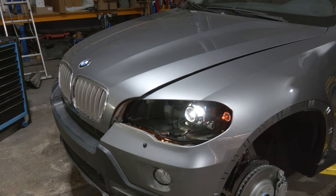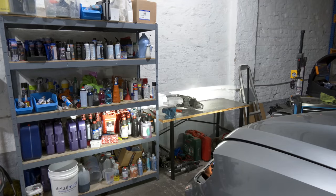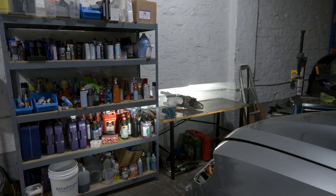Turn signal, high beams. These are bi-xenon projectors. So when you pull the high beam lever, it opens the flap and the projector is shining with its full power. You can see how the projector goes up and down and left and right really quick, and then it centers. That's how it should work.